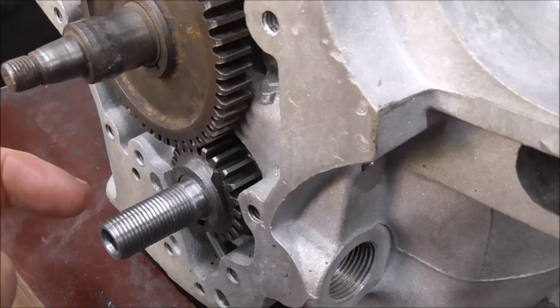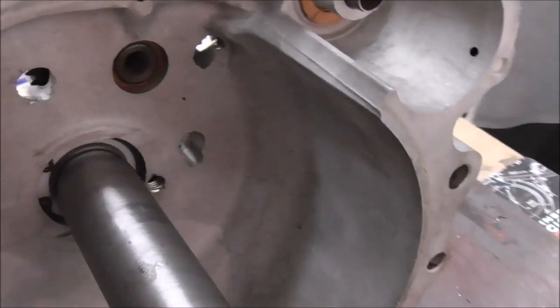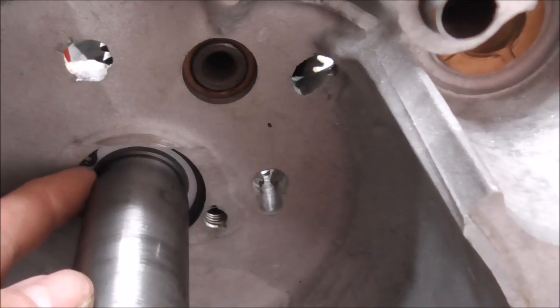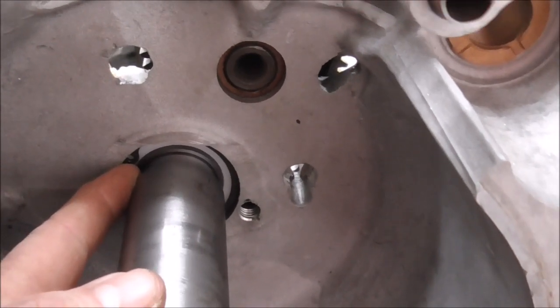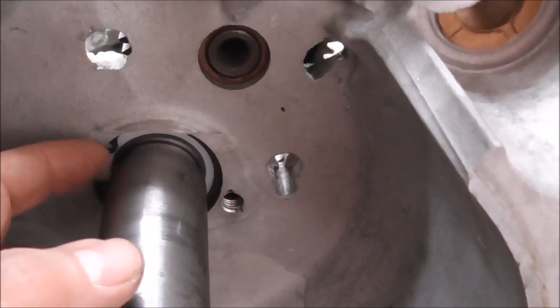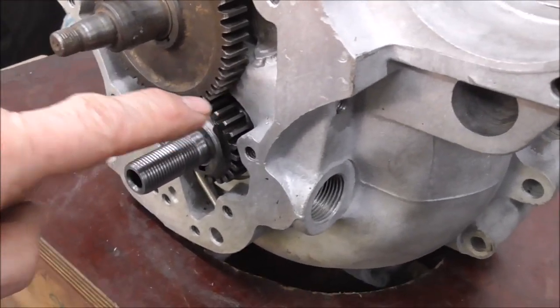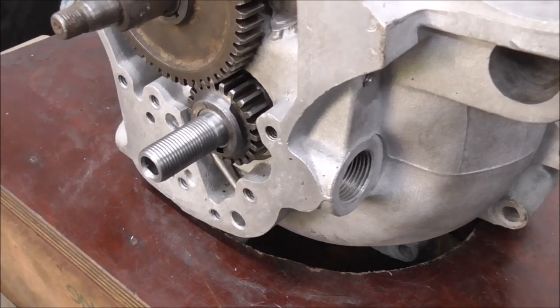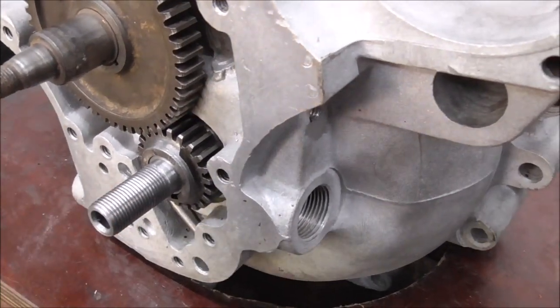That's where I want this temporary crank to land. And I've got around the other side - fortunately that inner ring off the proper bearing just went into our temporary plastic bush. So now I'm just going to make a little spacer ring between that and this shoulder, and then I can work out what spacer ring I need on the other side of this bearing - this gear rather - when we've got it all sort of temporary assembled again. I'll disappear off, make a ring at the back of there and then we'll be back again.